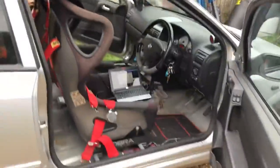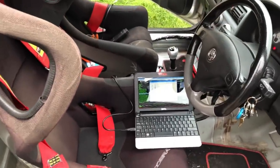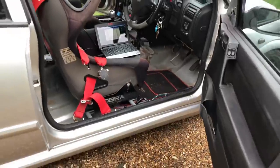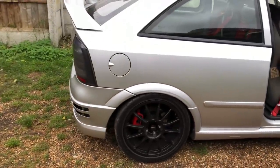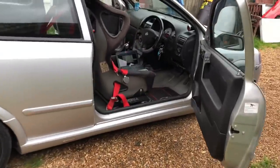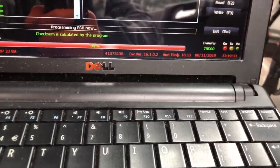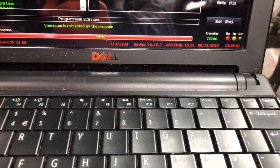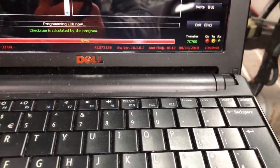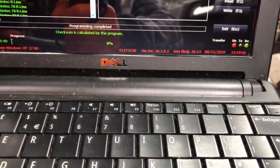New day — a bit cloudy. We spent all yesterday testing the car and just need to make some final adjustments. It's currently holding around 20 PSI but we want it around 22 PSI. It's really picked up some power. Finishing off the ECU flash now — you can see the progress bar on the map, nearly done, 94, 95 percent — that'll be done in a second. We're about to start up and give it another test, check boost levels and fueling, and hopefully get this one right.